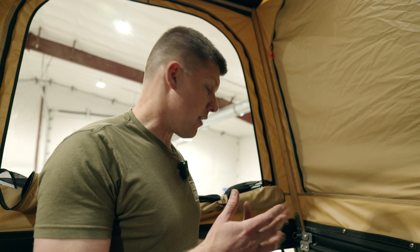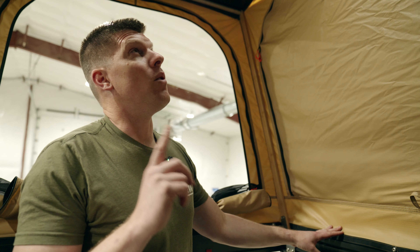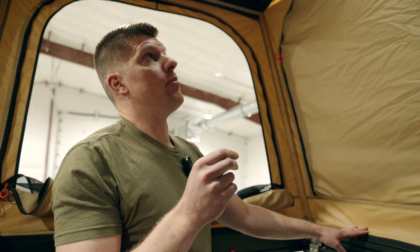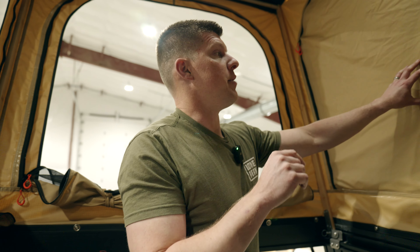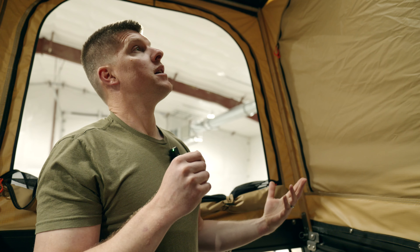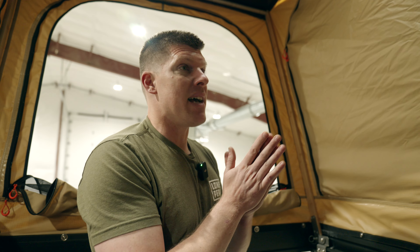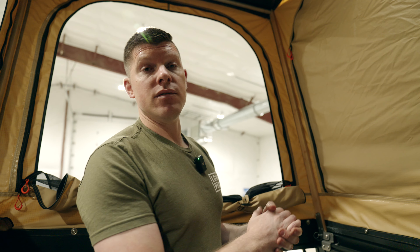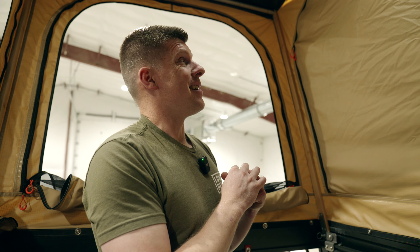I'm trying to share all the different changes we're making to the interior. The roof supports will now have a T-slot track built into them, which will help us mount insulation panels. We're also adding a bungee system on the tent, kind of like the Super Pacific, to help it fold up and not pinch — a bungee that pulls in the tent material. I hope this was helpful guys — keep asking your questions, because your questions basically dictate what content we make. We want to give you an accurate picture of what you're buying. I'll see you guys next time.